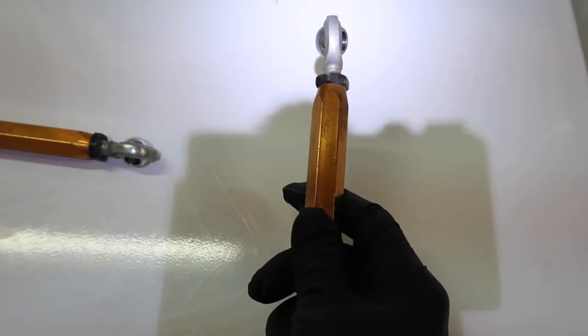I have spherical end links, and my experience with those has always been they last about a season. Rain, dirt, grime — they're just not meant to be on the road. So I figured the spherical had to be bad; it seemed the most likely suspect, and I had just replaced the camber plates so it wasn't that. Last weekend I decided to go through the car. Got it in the garage, disassembled everything, and lo and behold the end links were broken. Both end links developed play — not a bunch, but they were also bent. Right there I went, ah, that's it. Perfect.